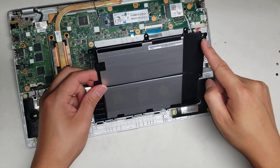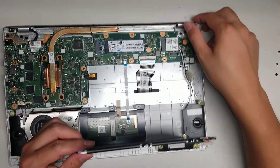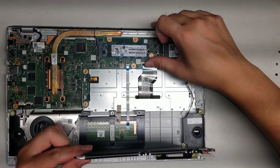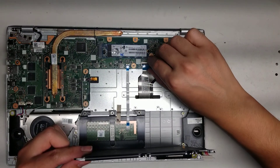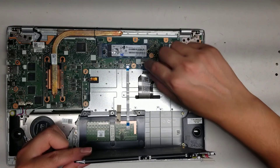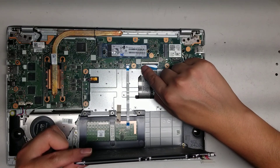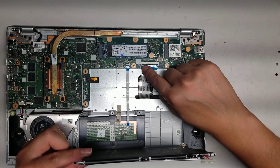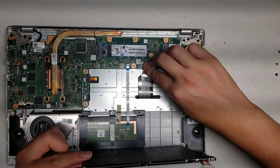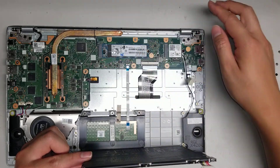I got the wire out from this little side and I'm lifting the battery. You can see the keyboard cable here. To remove the connector, you just flip this latch up and then you can pull the cable out. Sometimes you have to lift it slightly because the plastic wings are held by these little raised notches, so you do have to lift it at an angle when you pull it back. You've also got the trackpad cable connector and the keyboard backlight connector here.